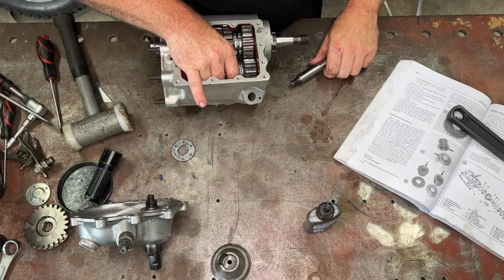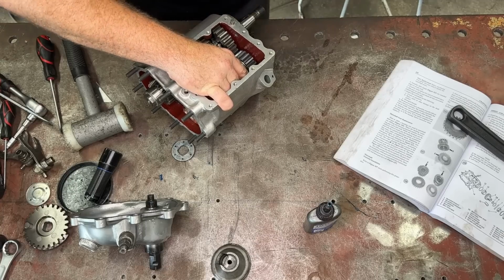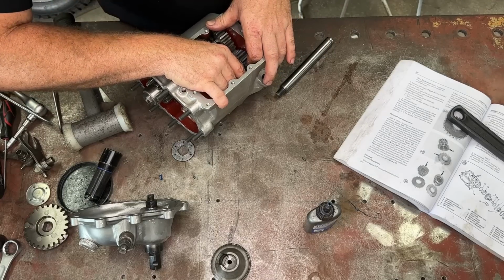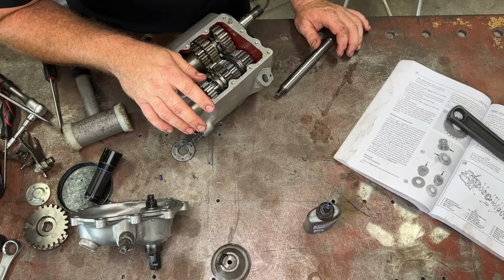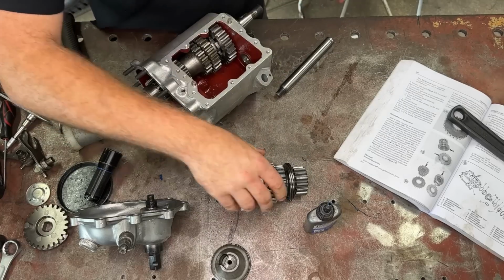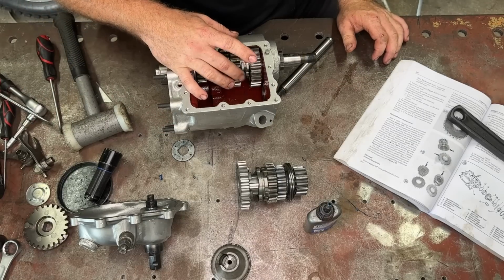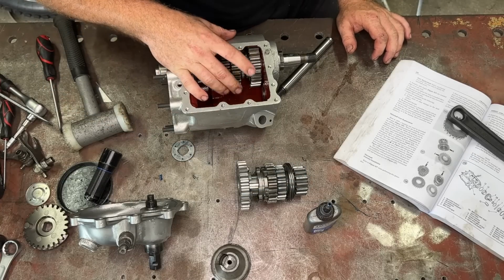Oh, you're... Is it? It can't be. It's that close. The third must be too big. Must be too many teeth in it. That's not right. It's not meshing properly. Third is too big. So I'm having meshing issues here. There's something to do with this third gear, it's not meshed correctly with this gear. So something here is the wrong amount of teeth.